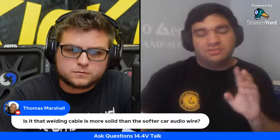Because these things right here, these XY PWM modules, oh yeah, those are pretty cool. Yeah, I wanted you to show those. You can see that. These can be found on eBay. A couple other companies sell them. So what these do is they are voltage manipulators. They're not regulators. It manipulates the voltage to the alternator. So you can pretty much adjust that on any GM 2-pin alternator or any Ford newer 6G alternator regulator.